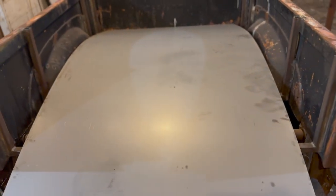Because otherwise, if I just welded panel after panel made over our arch, you're likely going to be going down the road and you'll hear the floppy floppy all the way — almost like a snare drum.